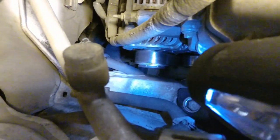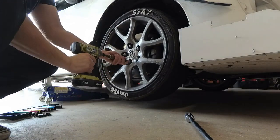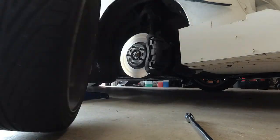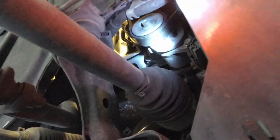Not this pulley, but there's a pulley underneath. You can see that right there — there should be a pulley right there. I'll go ahead and show you from the wheel side so you get more of a visual. Here's the axle, and that pulley right there where that little bolt's at — that one right there is the one you're going to need to loosen up.